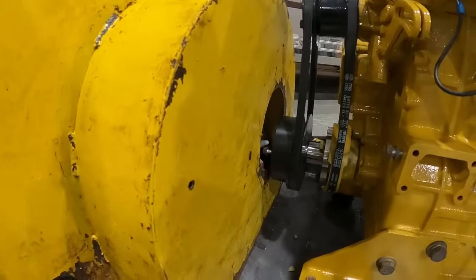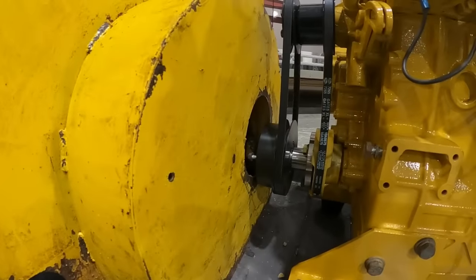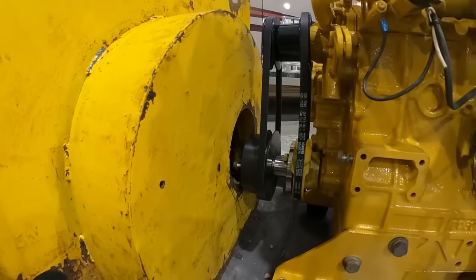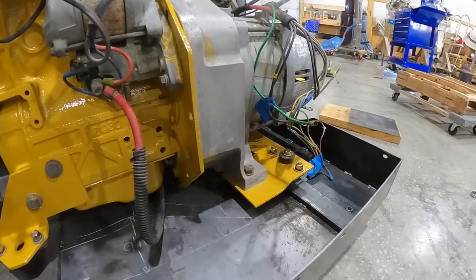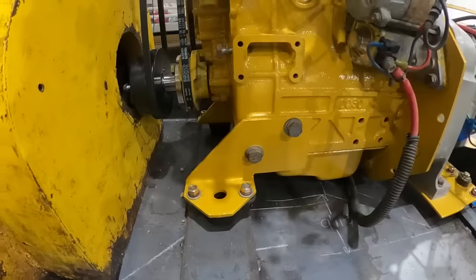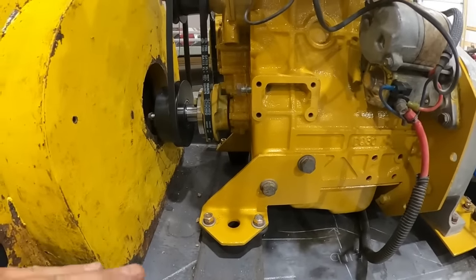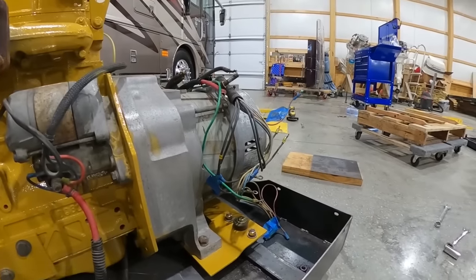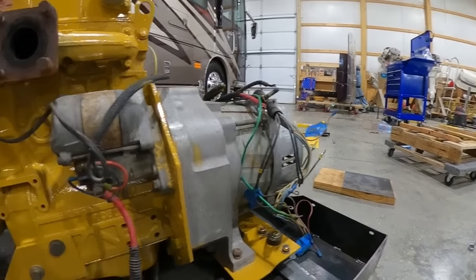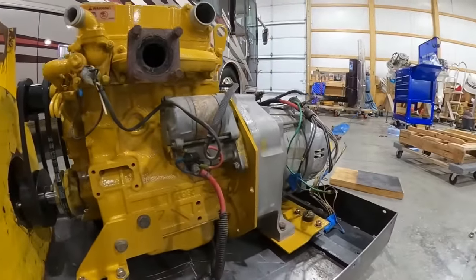Yeah, that's good. I mean, that's a what, half inch, three quarter inch difference? So that's definitely not going to work. Why is this 3/4 inch lower than it used to be? That's the question, I guess. Shouldn't be. Engine mounts are in the same place, same engine mounts. I'll measure from here to there and there to there to make sure those are the same size. Maybe those are taller and I just got them both backwards. Not likely. I put them all next to each other.